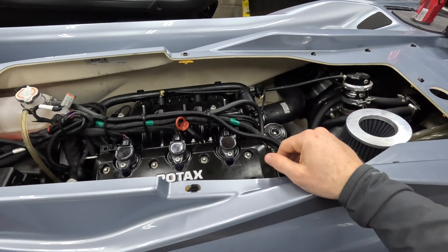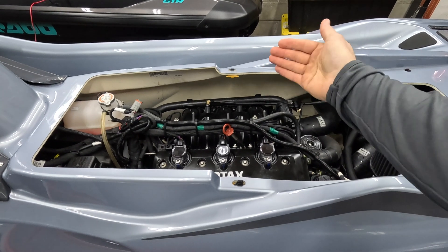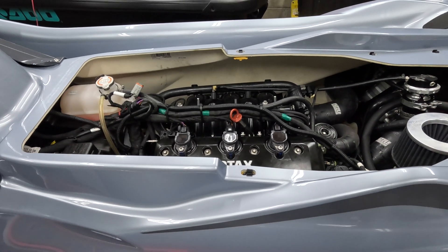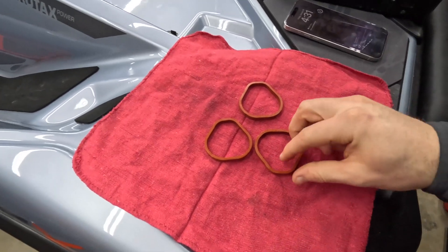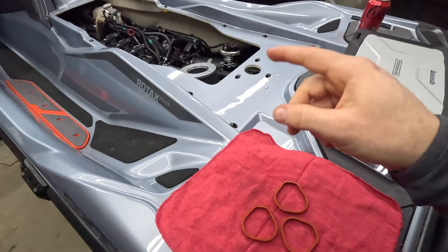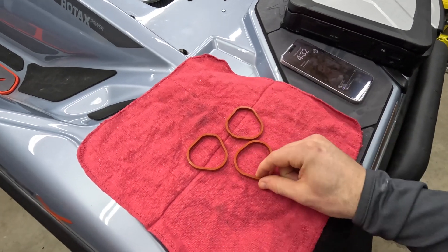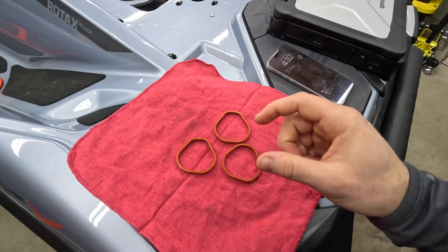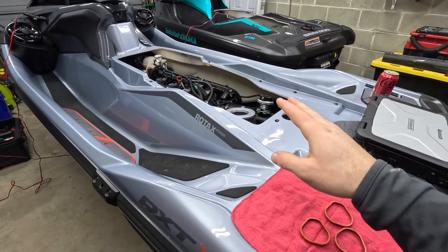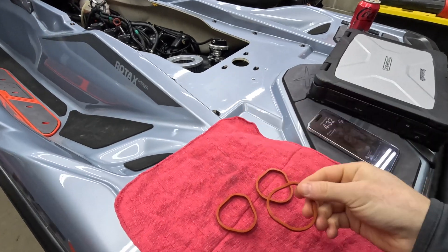If you're already aware that you have the problem, I'm going to show you how to fix it. It's going to look more complicated than it actually is, but essentially all we're going to do is disconnect the intake manifold, take those spacers out, and shave some material off. It's very simple. These are the old-style intake manifold gaskets — I have a box full of these, so when I take my manifold off I'm going to see if they're the same size. That $140 kit comes with these gaskets and shortened studs, but all you need for this fix is to shorten those studs. You can do it for absolutely free.